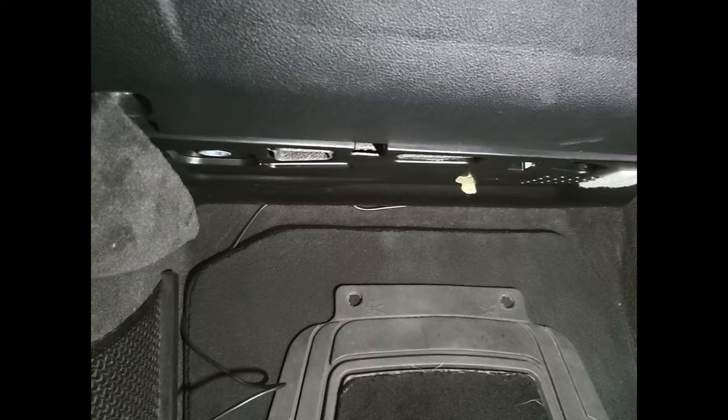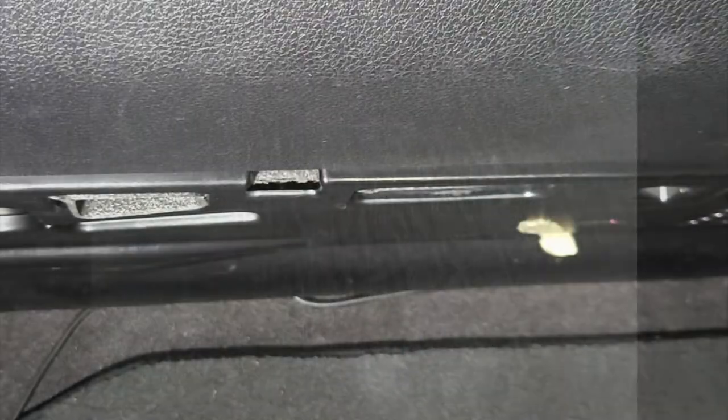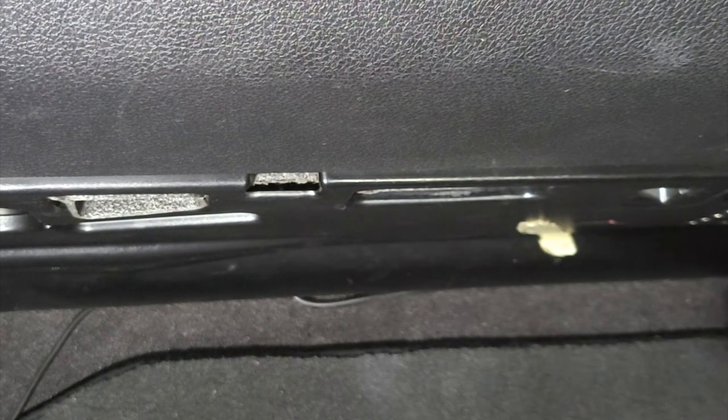It slides in — so it's back in. This will give us enough clearance to move it to the side and drop the airbag. After removing the T20s, we now have to move to the Phillips. Just to give you a visual — we removed the T20 from there, now we're going to remove this Torx, which could be a T20, and did the same thing on this side. It looks like a T25 will do it, so let's go at it. Another T25 on this side.